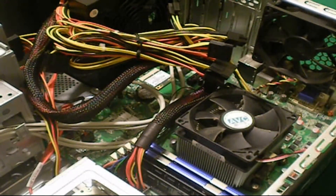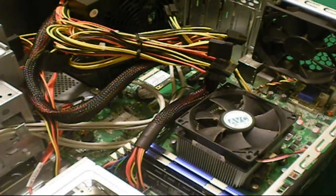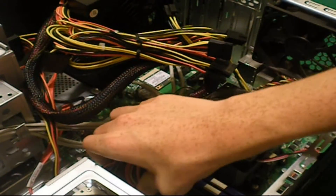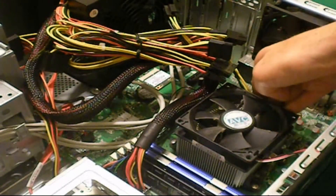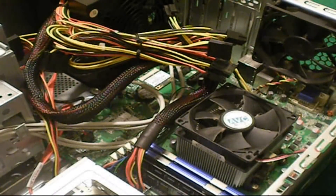I've plugged in my CD drive, which is basically the same as the hard drive. If you have extra components like a second hard drive, plug those in too — pretty much everything you unplugged, replug with the new PSU. Make sure your cords are nicely bundled and not blocking any airflow. I tried my best given how much wire there was. If you later see heating problems, you can rearrange the bundle.